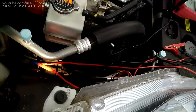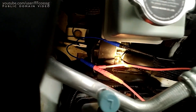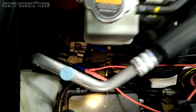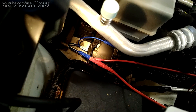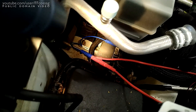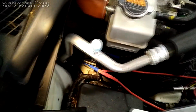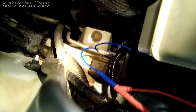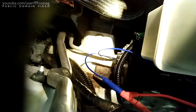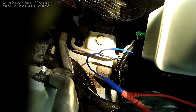If you want to manually rig one of these pumps on this particular model, on a LEAF the pump will be mounted in this direction. You want your positive lead — battery positive — on the top pin toward the side of the car, and your negative pin on the bottom pin toward the side of the car. So positive on top, negative on bottom.